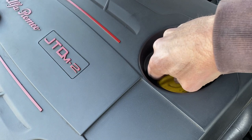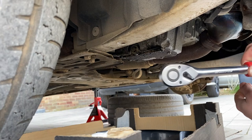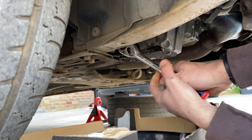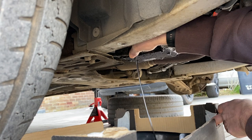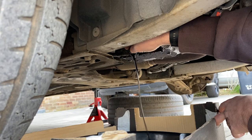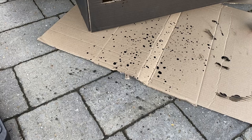To help the oil drain, I'm going to remove the oil cap to stop there being too much of a vacuum inside the engine — it should help it fall out a lot easier. We've got a 30mm nut to remove, our socket ready, and our drain pan underneath inside the extra box. Let's get this off. Okay, I think we'll leave that to drain now.